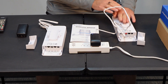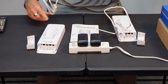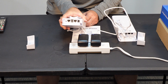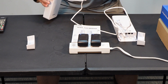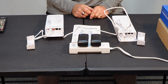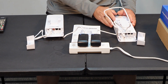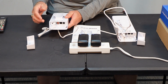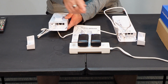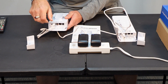The same setup applies for the slave unit. Plug it into power via the PoE port, making sure this one is set to B for slave, then plug it into LAN one. So on the master side, the modem is plugged into the LAN port of the PoE adapter into the master unit. On the slave side, whatever you're going to use it for — say you want to set up a remote Wi-Fi — you would plug your Wi-Fi router into the LAN port on the slave's PoE adapter, then from the PoE adapter to the slave unit.